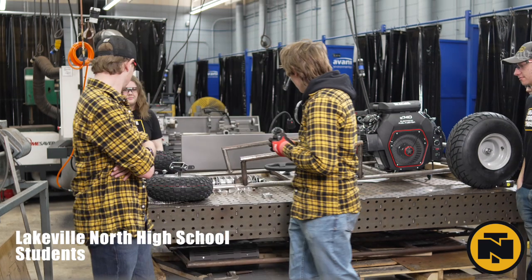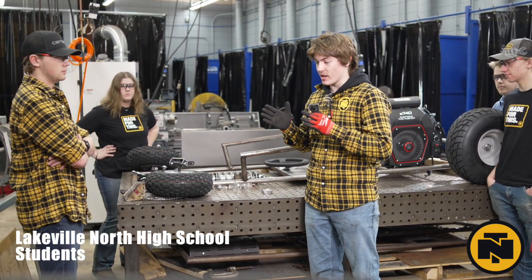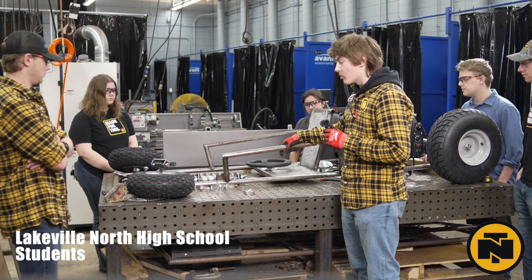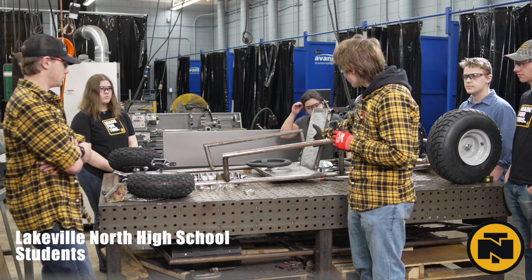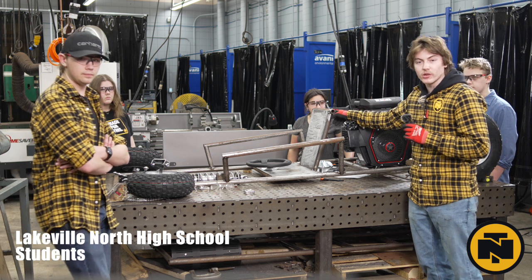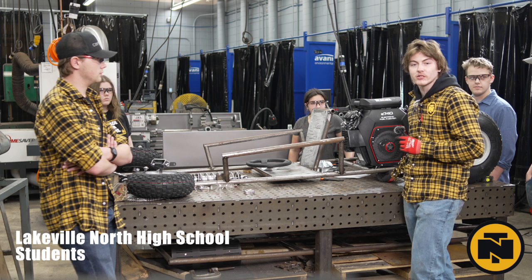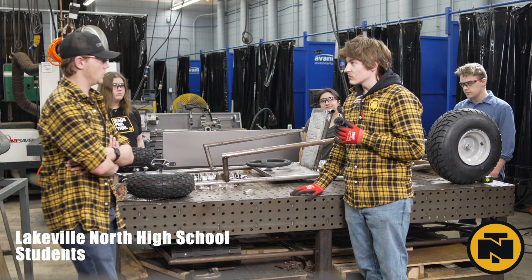So to start, in the front it's a straight chassis right now, but we plan on taking the front and notching it in so it tapers in the front so it's not square. And then if we move back, we have these two little roll bars right here next to the seat, and in the seat we have a base plate going all the way across, and then one plate coming up that's supported by a couple pipes. And then if we move back a little more, we have two pipes that go all the way across the frame with a base plate underneath to help support the engine, and obviously that's where the engine is bolted. And then in the back, we aren't really sure what we're doing with the axle yet, but we're going to try to mount it above the frame so it's kind of a straighter line from the crankshaft to the sprocket.